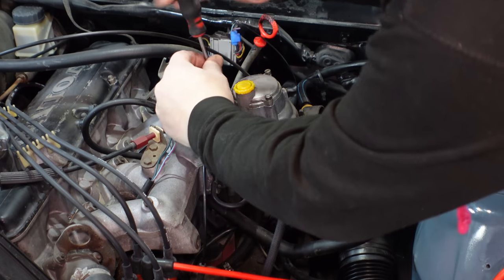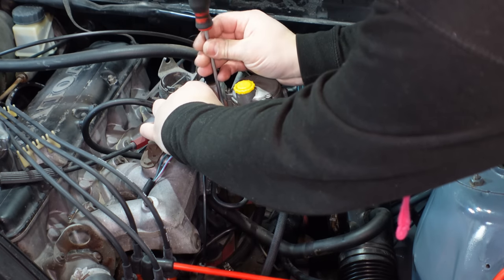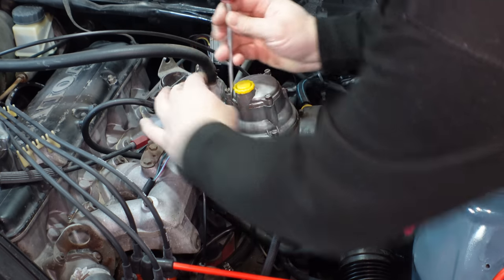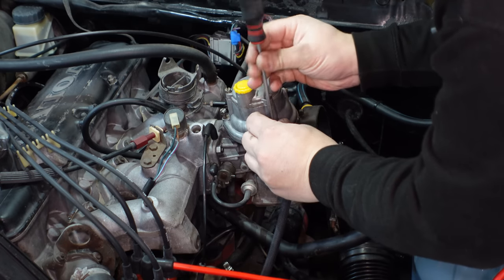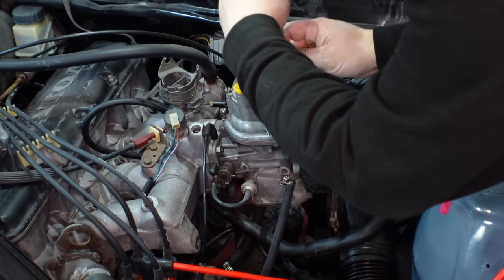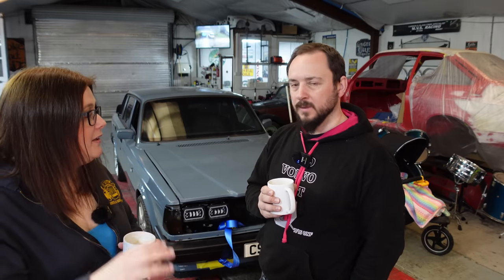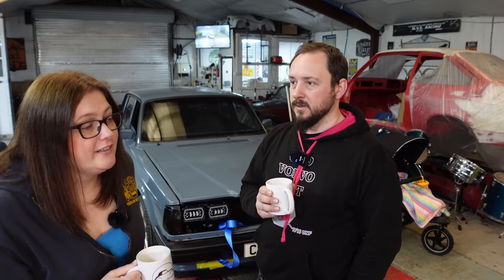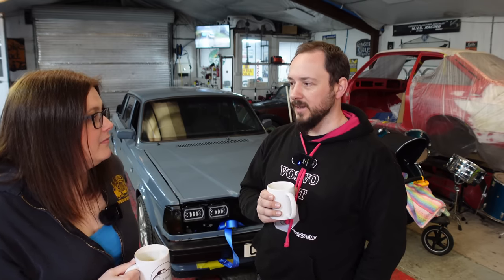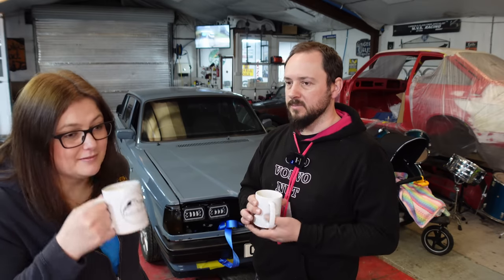So I said that's it — we're going back to square one, checking through everything. Rip the carb off, sort out the diaphragm, clean out the fuel bowl, clear everything out, put it all back together and rebuild it. We reset the fuel mix ratio to factory baseline. Then: charge the battery, crank on the ignition — nothing. Completely dead. Pull it around the field again.